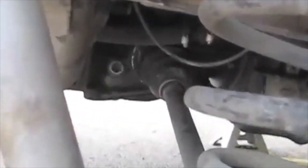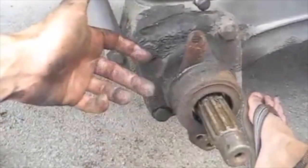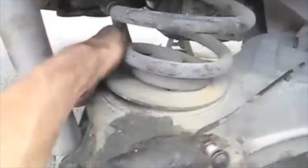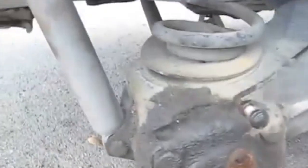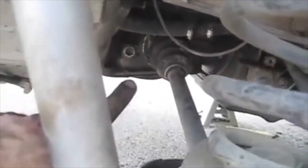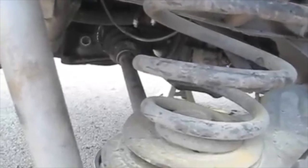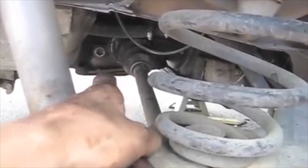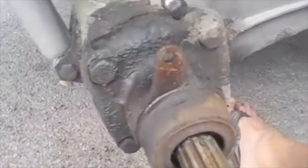To start off, I loosened the bolts. I'm going to do the CV axle out through the hub, basically out through the trailing arm, as opposed to loosening it inside and pulling the hub off with the stub axle. Since I'm going to have both sides off at the same time, I loosened all those triple square bolts — or some people have Allen bolts — so that I can take it off and take the thing all the way through.